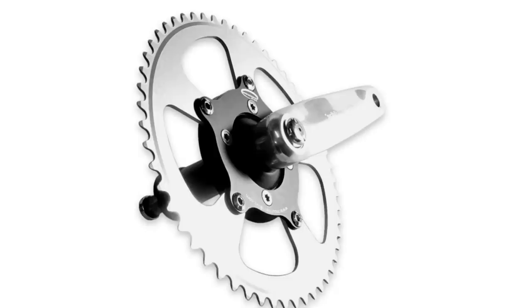I think it's a good concept, but there are some issues. First, it's potentially quite heavy for the style of system it is. Second, it involves having a quite large chainring because of the way the system works, and that chainring sits in a central position. Most mountain bikes — even one-by bikes — are designed around a smaller chainring in that middle position, so you're very limited on which bikes can accept it. You could space out the whole crankset, but it would put your chain line off. Also, the design has minimal sealing to keep friction low, which means it's not really good in wet weather or mud — it's going to get into those gears, and it's not designed for those conditions.